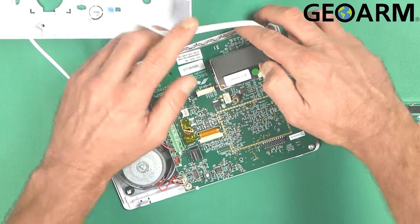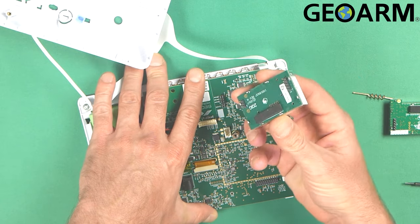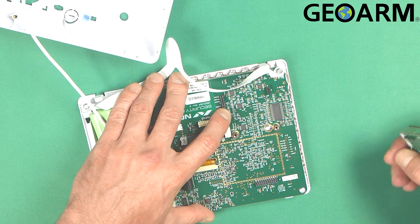What we're going to do here is find the current transceiver module, which is located here, and then just wiggle that off like so. It comes right off. You can see the little clamps and slots that it goes in. We're going to go ahead and put this one to the side because we're not going to need it.